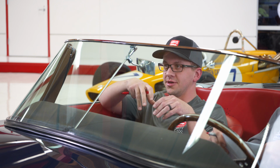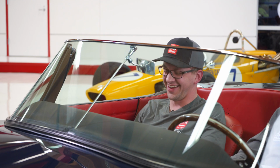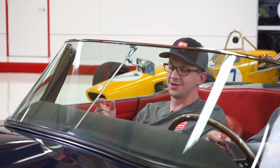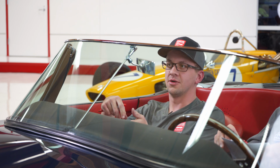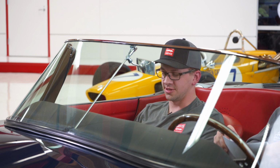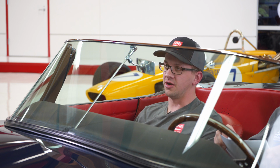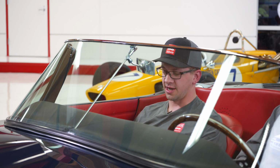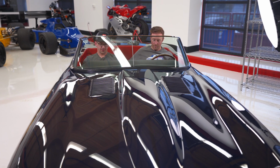I was working on that red Ferrari 328 a couple weeks ago. Those have the obnoxious louvers over the engine. Beautiful louvers, obnoxious to detail around. Not obnoxious to look at. But even our G8 with the 1-inch extension, I couldn't get between the louvers on the edge of the paint because of the orbit throw, making it a larger footprint than 1 inch. So I used the 1-inch backing plate on the GR3 with a soft foam pad. I didn't create any hologramming because I was doing it very, very gently. That got the majority of those defects out, and I was able to get that job done more thoroughly. So, awesome tool.